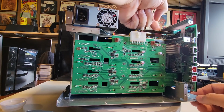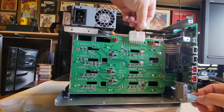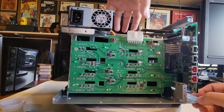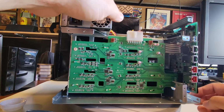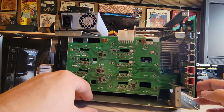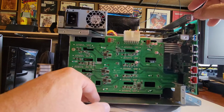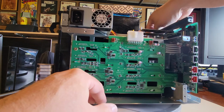If this little back plane were to fail for whatever reason they're plugged into, or if I need to replace it, nice finger screws right here. I like that. I don't have to have any tools for that, except for just to kind of take off the lid, 2 little bolts, and I'm into my NVMe. And then I can get into the system board side, which we are going to take out because we want to see that, right? You can kind of see it's got a connection here and a connection here. So we're going to want to disconnect the power supply from the system board.